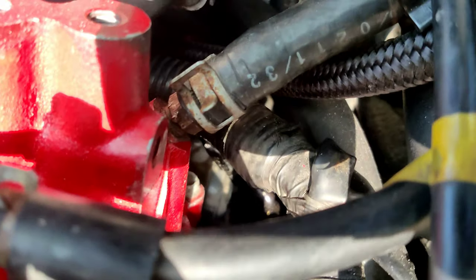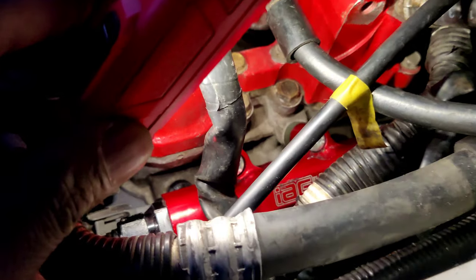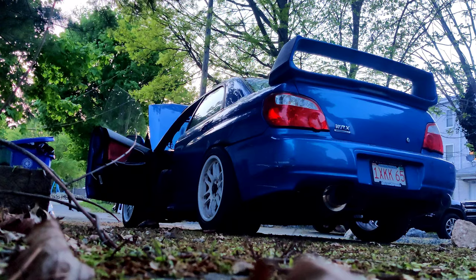Yeah, it is. Kind of hard to tell, but that rear injector, it's literally leaking right from the top O-ring that I just changed. So I'm not sure if I'm just putting that in wrong, but I'm gonna take it out one more time and replace it again. All right, so I just turned it on real quick just to make sure that it wasn't leaking, and it is pretty dry down there. I ended up just having to double gasket it, which, I mean, I would advise against normally, but it worked for me, so that's what I'm doing.